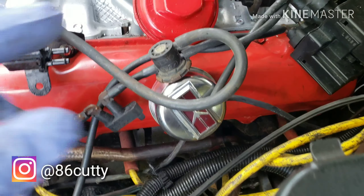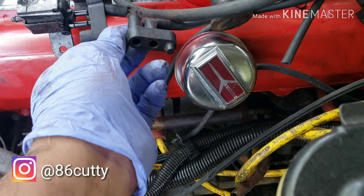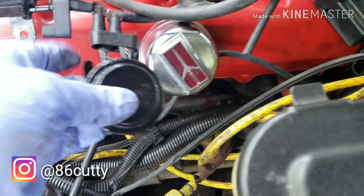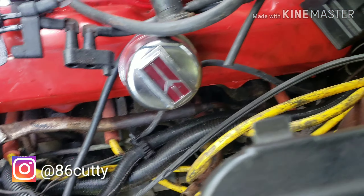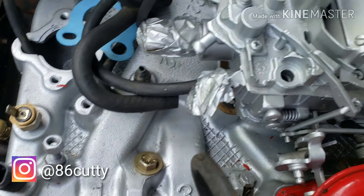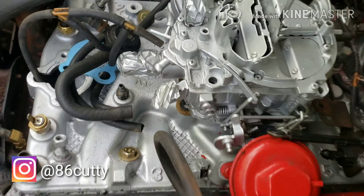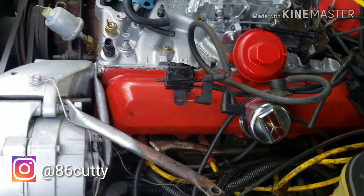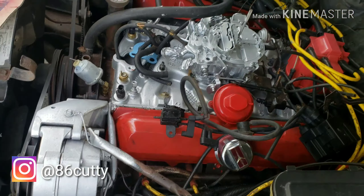What I'm doing now is I still gotta wipe everything down, but it's basically like I left everything plugged up to a point where I can figure out where everything goes. Like, little stuff like this is only going to plug in one way — this plugs up in this box over here. So I gotta do the vacuum lines. All these lines I think go to the carburetor, and there's some more over there. So what I'm gonna do now is bolt the carburetor down and do this vacuum line. After I do that, this car should be started up maybe today or definitely tomorrow.